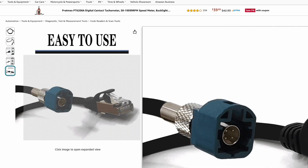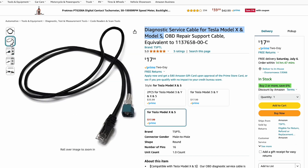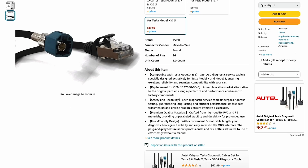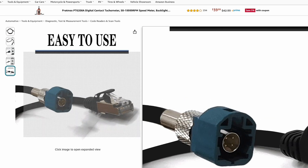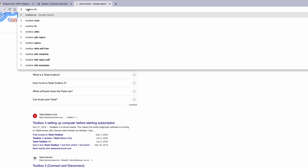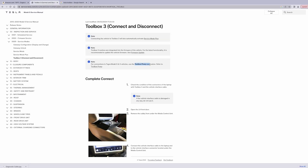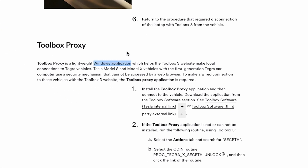After getting this all working, we're using a dedicated diagnostic cable — ethernet on one end and a dedicated connector to the car on the other. There's no way to accidentally plug in a crossover cable. This was bought off Amazon. In terms of computers, the Tesla Toolbox software runs in a browser and is Chrome-based, but unfortunately with older cars you have to run a little proxy program in the background, which is a Windows executable — so it won't run on a Mac.